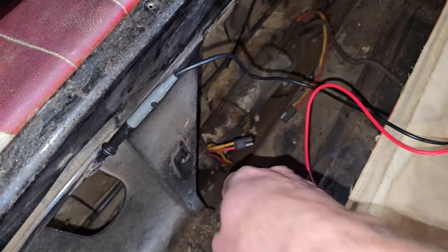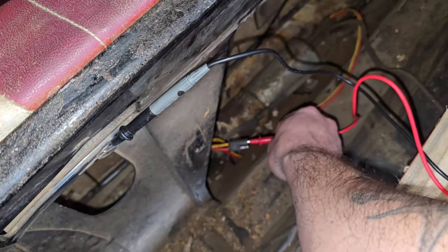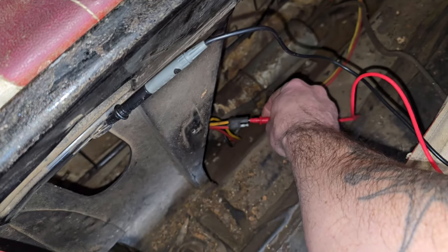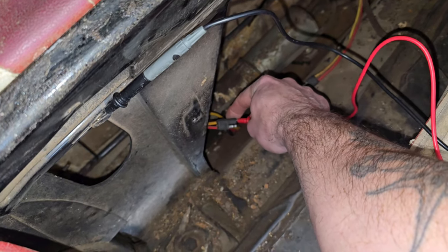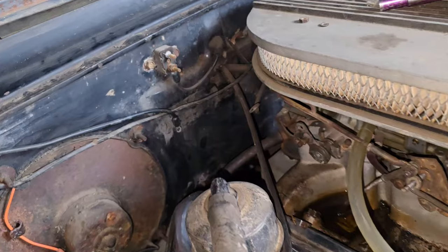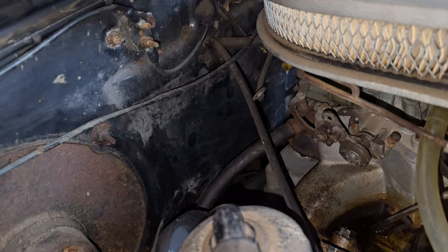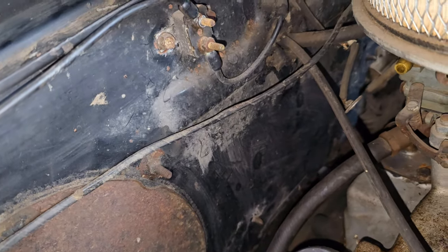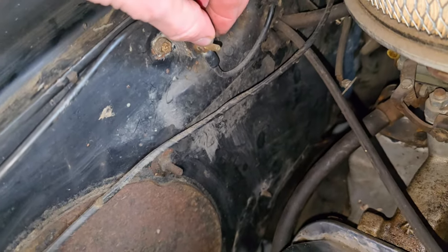Back to the rear, trying a few more things, and all of them are pretty unsuccessful. What we finally tried was testing between ground and the motor — sure enough, we do have continuity between the motor's leads and ground, so that's not good. We also found a two-post thing in the engine compartment connected to the solenoid, and it pushes power over to the switch.